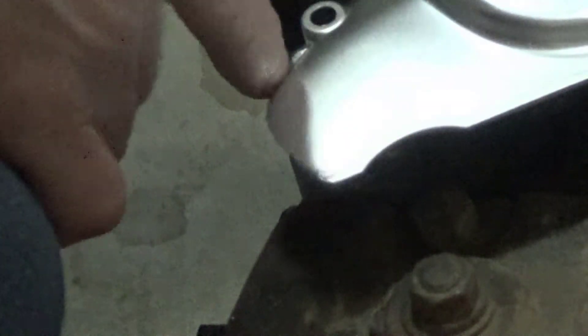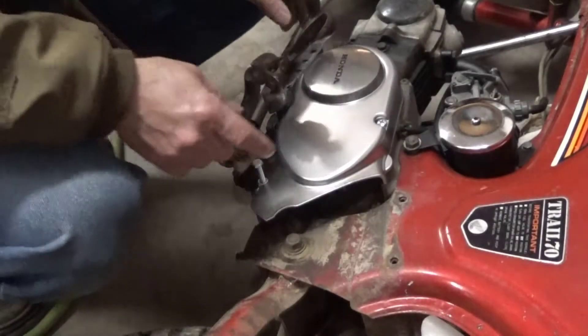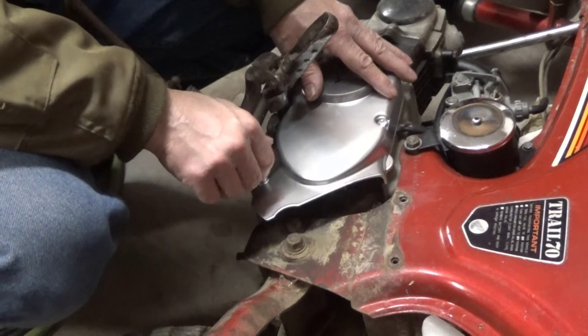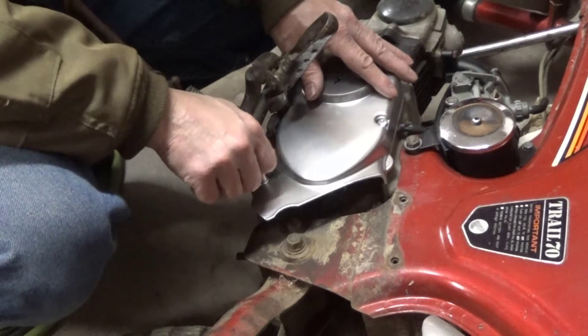The other side cover was bashed and smashed. What usually breaks the ears off right here is when the chain is running through. If the chain breaks or comes off, it usually breaks the side cover inside, and usually areas around the crankcase — it always ends up grabbing this ear and busting it. What I've done is gone ahead and put the side cover on, tightened the screws down, and I wanted to make sure this still lines up and threads. And it does — so that's a good thing.